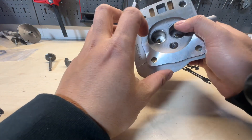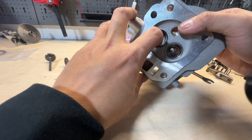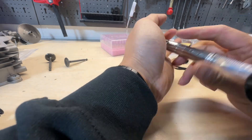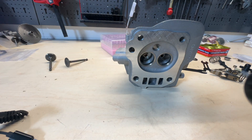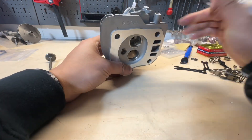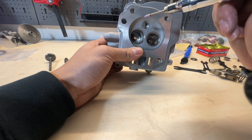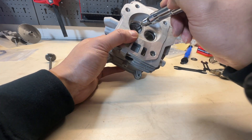This is the exhaust port, that's the intake port. This edge here is a bit rough, so we just need to smooth that part. The valve seat — if there's a bit of a step here, we'll smooth that out too. For the exhaust, same thing — smoothing this lip so it doesn't cause too much turbulence. This task is not particularly difficult, but you have to be very careful not to take out too much material. It's better to have a longer reach — just polishing so there's no step in between.